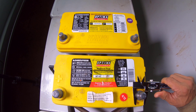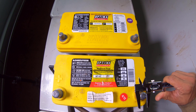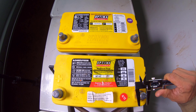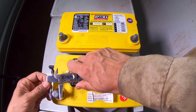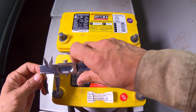As seen in this footage, the two batteries were the same physical size and cold cranking amps. The top posts for the battery terminals were different sizes. While measuring with the caliper it was also observed that on both of the batteries the positive top post was larger than the negative top post. Also on each post of both batteries, the width of the base on the post was wider than the width on the top of the post.